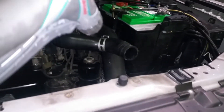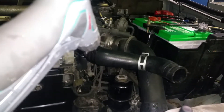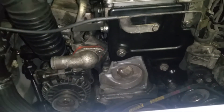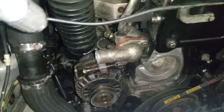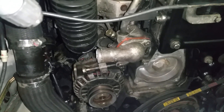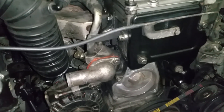I used a garden hose and put it to the top radiator hose, applying some pressure inside until the water came out through the pump. Then I put the hose inside the pump. Normally you would have to remove the thermostat to feed water through the inlet, but I was able to reach behind the thermostat with pressure through the water pump.